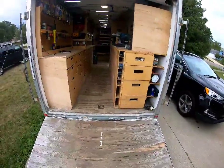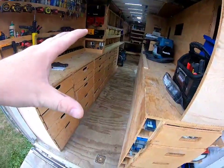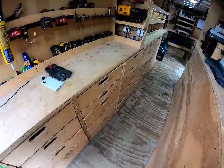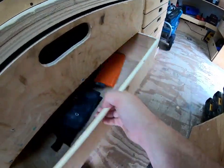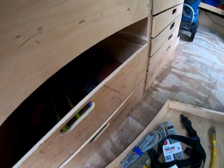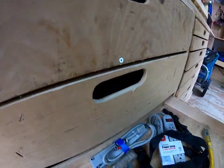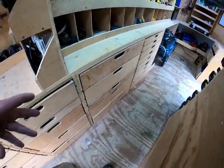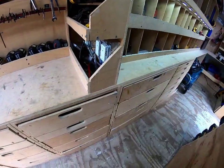That's all I have — like and subscribe, I'll see you in the next video. But I want to show one update that did fail: if you're building out your trailer, make sure you brace the drawers, because they're going to bow out like this. If you put a lot of weight in them and drive around a lot, they're going to fail. Make sure you add a brace in the center section — you can see the brace right down there. Definitely add those to your build because it's going to save you some headache for sure.